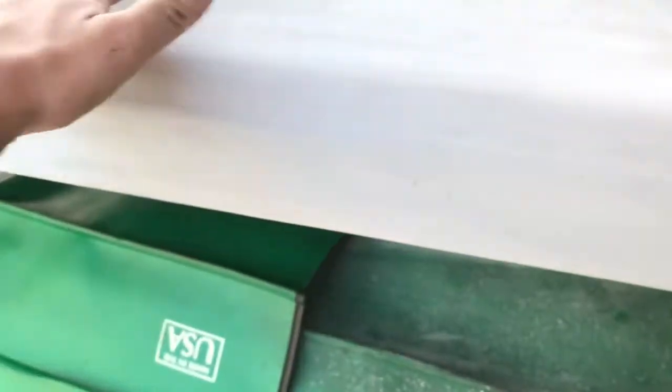See that? It's really like a rough mark. That's where I did that second coat of Bondo. So I think I just gotta go really high all the way across. Take it all down. Trying to fill in lows afterwards. I think that was a filling of a low spot. I'm trying to get it all to blend now. It just doesn't work that way.